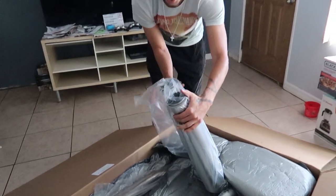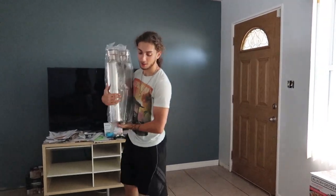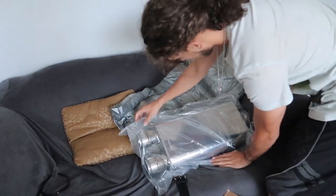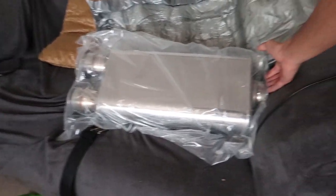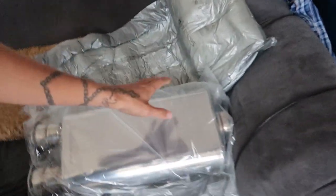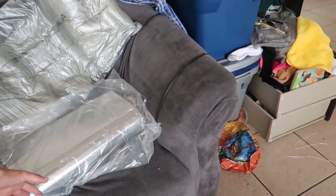This is our muffler. So this is gonna be the muffler that's gonna be within the mid pipe. This is gonna connect your two primary inlet tubes to your mid pipe dual exhaust, which goes into your Helmholtz mufflers and your exhaust tips. Basically, this is the middle chamber to your exhaust — this is what's gonna deaden most of your drone and cause that light rasp and really deep growl.